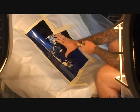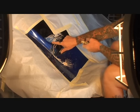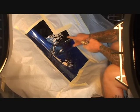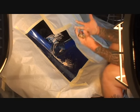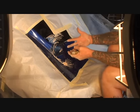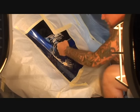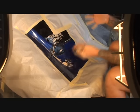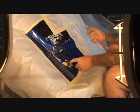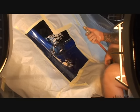What you're looking at right here is all these lines. I cleaned all the cracks out. Gel coat is basically like glass — that's why I call it fiberglass. The gel coat is a very hard substance, and when an impact hits it, it shatters just like a piece of glass. You've got to cut those shatter cracks out, each individual one.